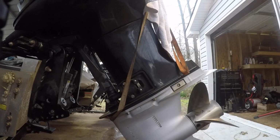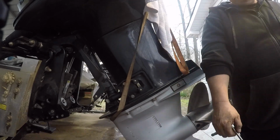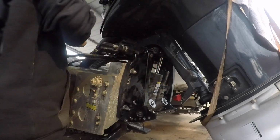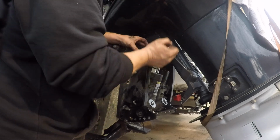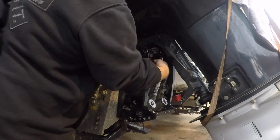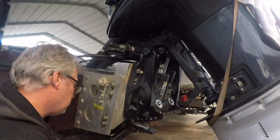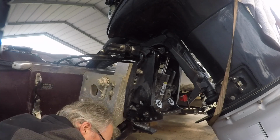Okay, so I'm just fast forwarding again through here. But basically, I put the reservoir cap back on after I changed the O-ring on it, and I was trying to figure out how to get to the bolts. I should probably just show you, but I used a ratchet, an elbow extension, and I think there were 10mm bolts, and then a couple of extensions, and I also had a 10mm box wrench. With that combination I didn't have to take the trim off, so I was able to get back to the bolts and get them in, and I also had to use a magnet.